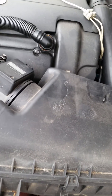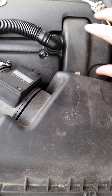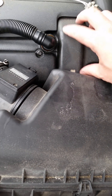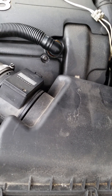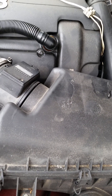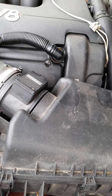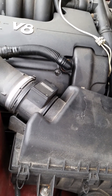So this one, just running and listening to it, sounds like it's making a hard knocking sound somewhere from the front of the cam cover on the driver side bank here. I'm trying to diagnose just what that is, whether that's timing chain. This particular engine has had new timing chains and tensioners in it not long back, so I'm not expecting those.